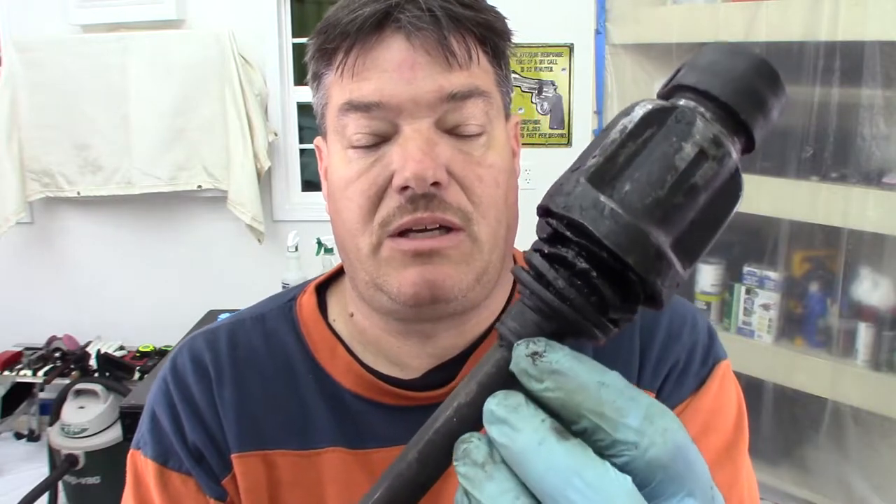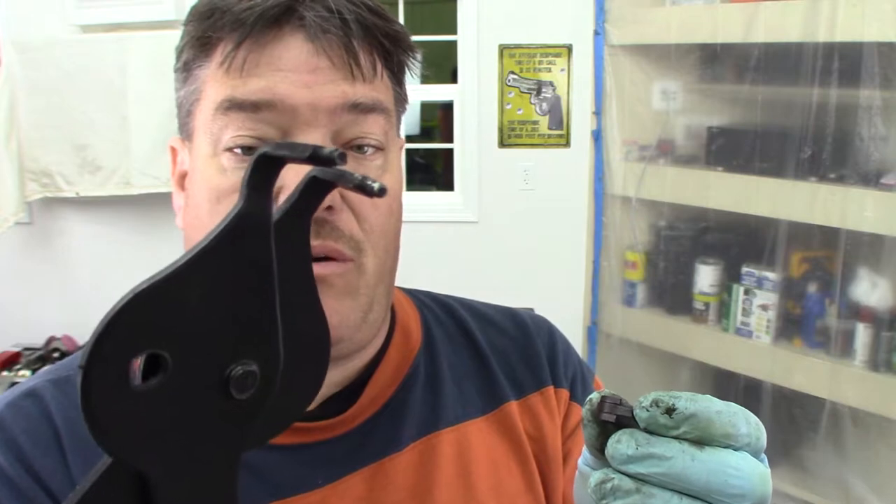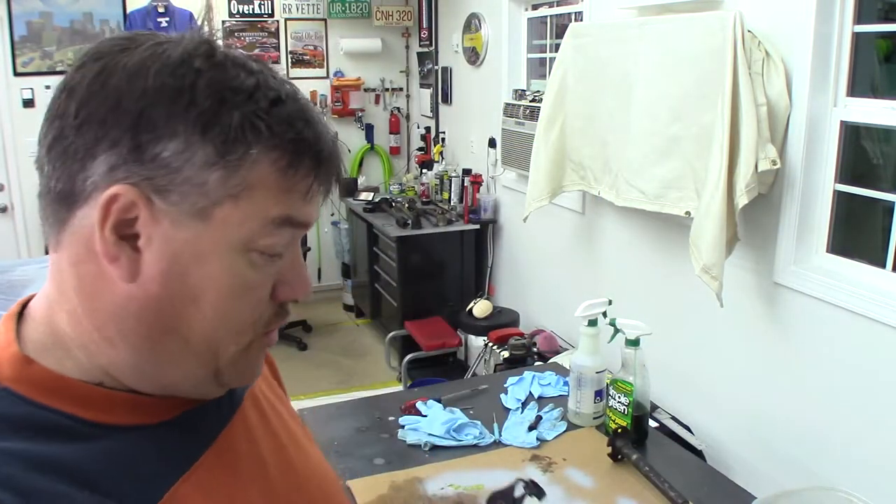My next step on this steering shaft disassembly is going to be this clip right here. You guys know by watching this channel that I'm a big fan of the original fasteners, and these are a pain to take off without the right tool — and I don't happen to have a tool for this. Here's a better look at this clip; this is a spare that I have. These break pretty easy, but what I've done in the past is use a pair of right-angle snap ring pliers, come in here on the bottom, work half of it down, then do the same on the top. If you get too aggressive you will snap it. I'm sure there's a special tool for this but I just don't have one, so these old cheap tools I have — they just come right apart with the set screws.